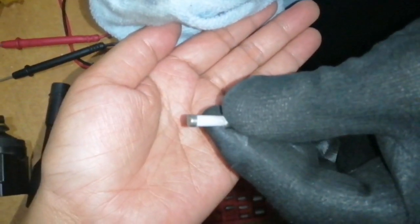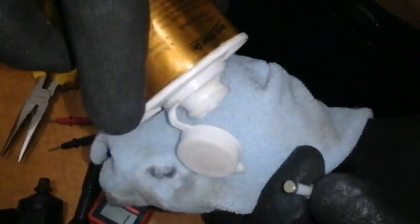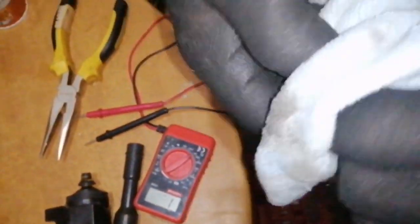Yeah, I'm just using my cell phone camera. It's quite difficult to focus. Okay. Just be patient with rubbing it until you get the desired shine. That means if it is shiny, then all those corrosions are gone, and you should have a good contact then.